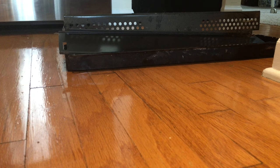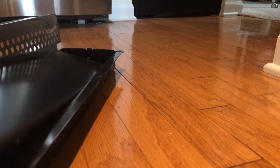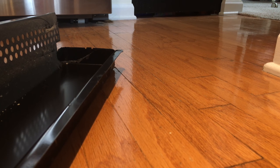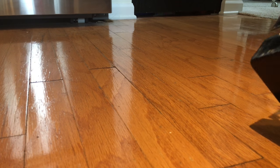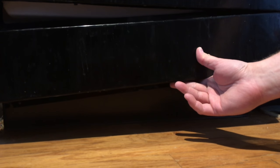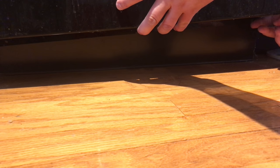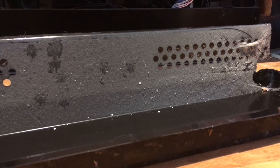The face plate here is two pieces — it connects like two pieces like this. What you're going to do is unscrew the first top bracket screws, then the bottom one. Once you get the bottom one off, this piece comes off here and the bottom one comes off here.